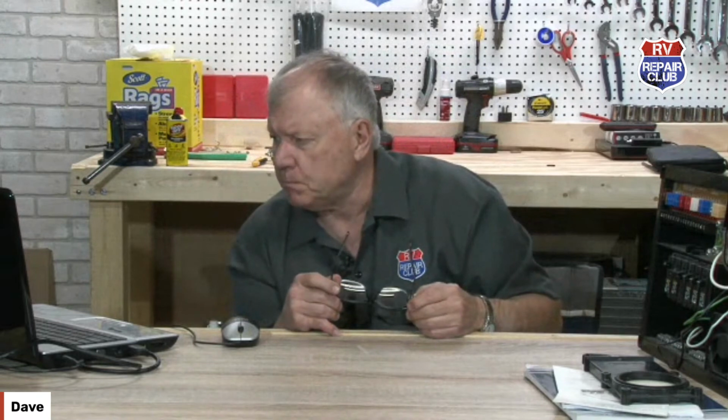So if it happens with the emergency flashers, then it's a coach problem. Winnebago doesn't tap into any of that stuff other than running wires back to the bulbs. And if all the bulbs are working and all the flashers are flashing correctly in the components that Winnebago put on it, then it leads me to believe that it's something in either the switch itself or the relay that's on the chassis-supplied fuse panel. But I would say check with your extended warranty, and just see if it would be covered by them.